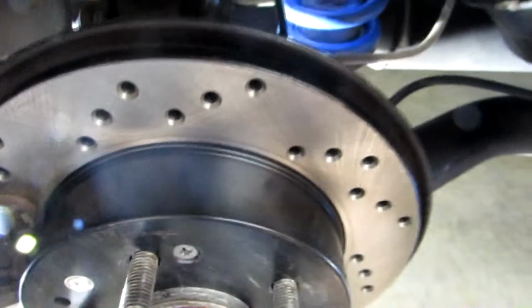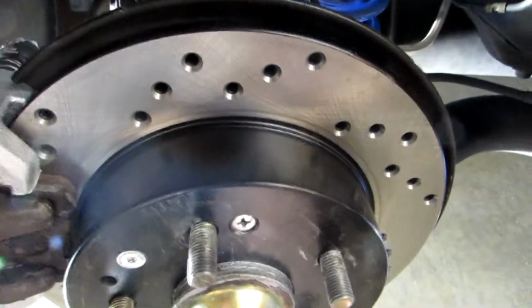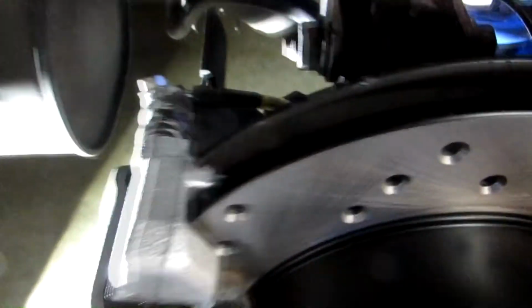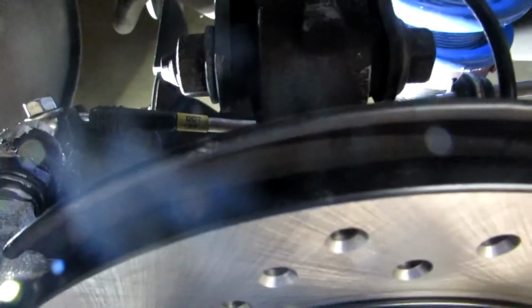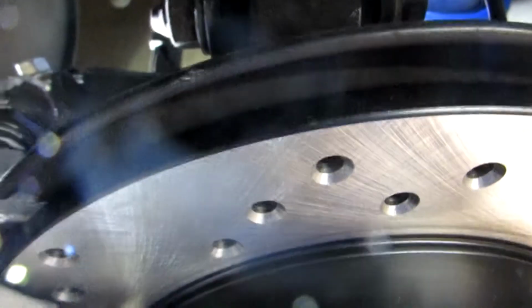And then once you do the installation, it should be the reverse of taking it off. Pretty straightforward. The only challenging part is lining up the camber control arm here, this arm here, back up with the hub. You might have to use a jack to lift up the suspension. That way it'll line up, and you can put the bolt back through.